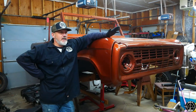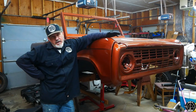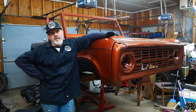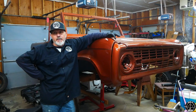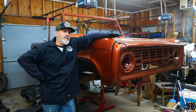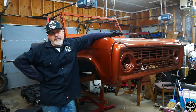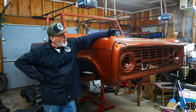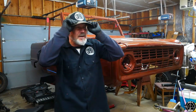Right now you're thinking, 'Chris, why would you do that?' For $800 to $1,000 you can buy really high-flowing heads to replace the GT40s. Or you could keep everything stock and go with an aftermarket intake. Or just do a cam swap. Cam swap, head swap, intake swap, or stroking — they're all going to make more horsepower. Here's my thought process, and it took me a long time to get here, so don't rain on my parade.